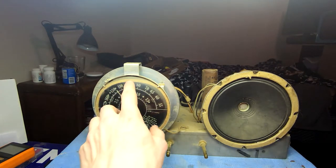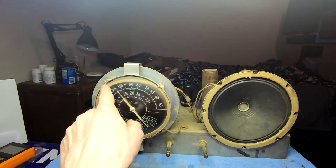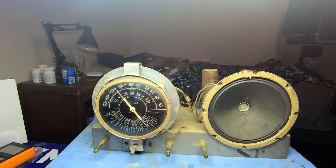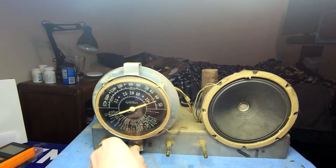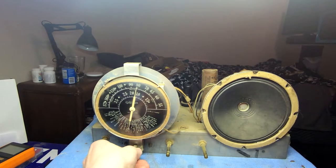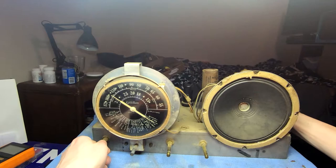I'll just put in a jumper wire and fill all of those holders — we should get very nice, hopefully not overly bright illumination since they're behind the dial cover which will act as a bit of a mask. There's also a slightly shrunken round cork gasket in there. I want to clean the glass but I don't really want to remove these little fingers holding it in, because if I break them off there's nothing to hold the glass in. There's also what appears to be a cadmium-plated reflector on the back — but that is actually part of the drive mechanism for the dial. It uses a pinch roller at the bottom — just two little metal plates grabbing onto the edge — and thankfully no rubber parts to deteriorate.